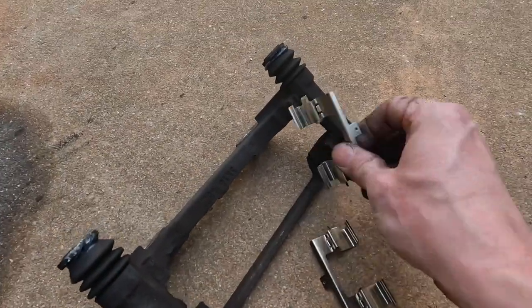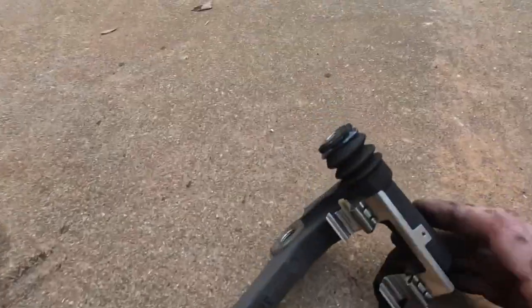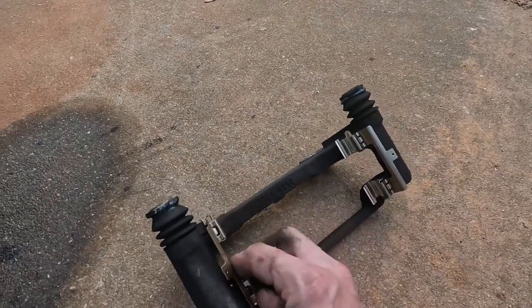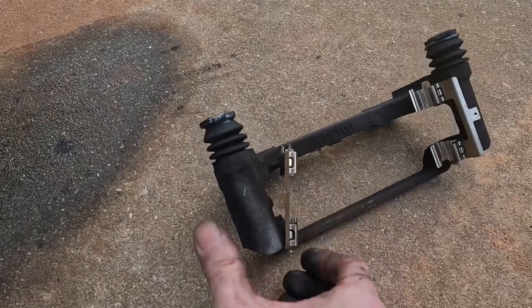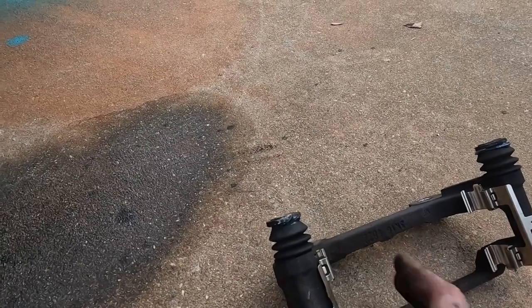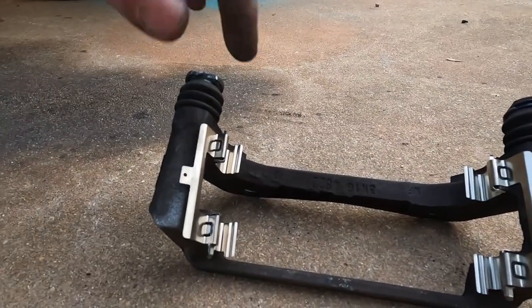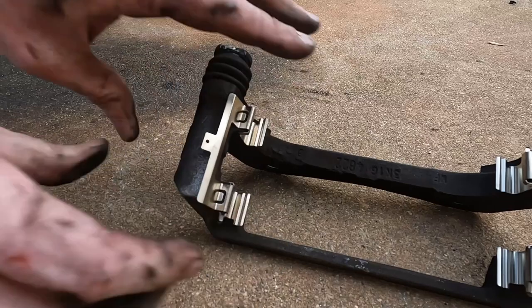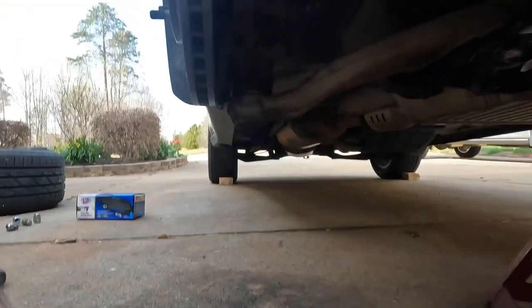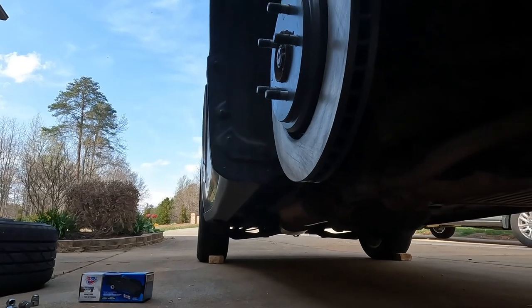Here's the kit that holds the brake pads into the caliper bracket. All you do is these things snap right in — they're very easy. Make sure you get the little ears seated. Once both are snapped in, put it back up and install it.